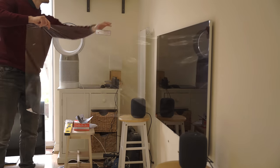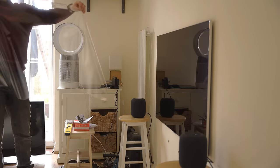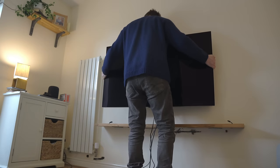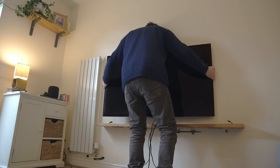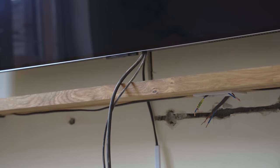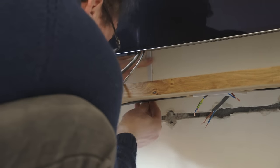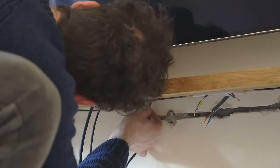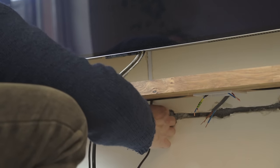There's a strong magnet that pulls the TV back into place so it's dead tight against the wall. I just love the way this screen sits on the wall. Now, one massive caveat with the LG Gallery Series: the power cable is permanently fixed to the unit with no easy way to remove it. The plug on one end is molded onto the wire and the wire is permanently installed into the screen. You could cut it, but that's going to cause a headache for warranty claims — and I didn't want to because it makes concealing the wire behind plasterboard very difficult.